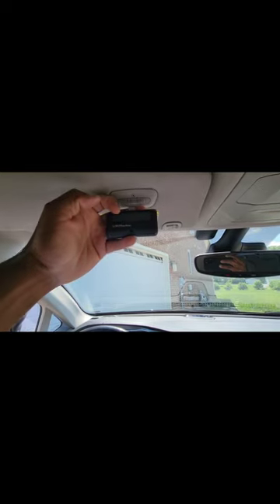We did not have a rapid flash there, so we're going to come back and see if that works. As you can see, the garage in the background — that did not work at all. What I found with Chrysler is you don't have to hold the transmitter right against it like most vehicles. You can have it a couple inches away, press both buttons, and you can see the indicator starts flashing rapidly. Release and just wait for the indicator to go out.